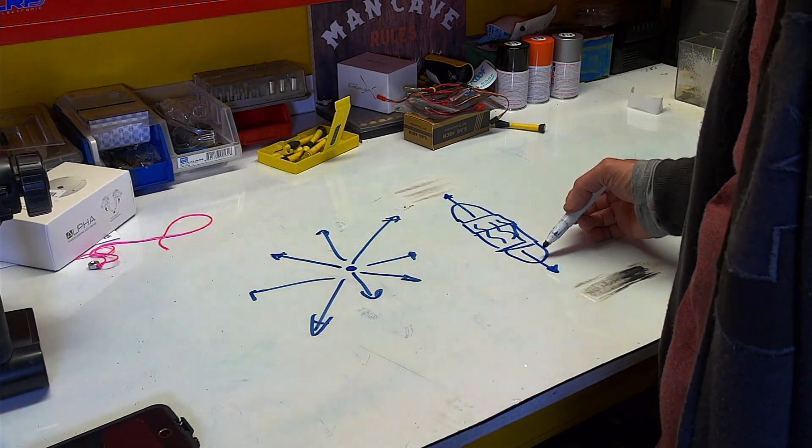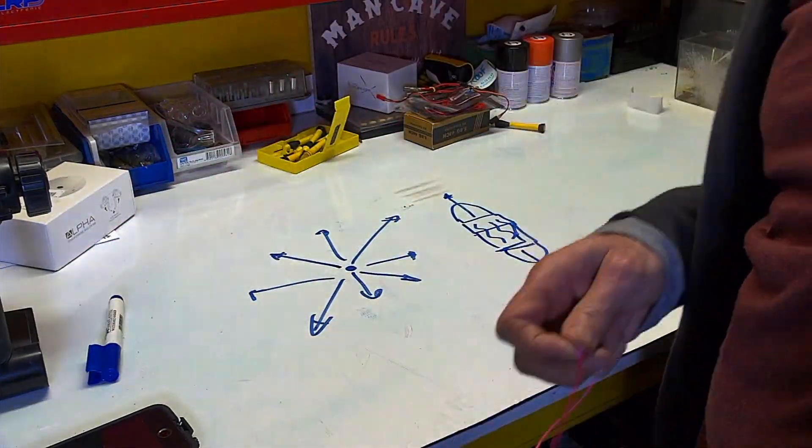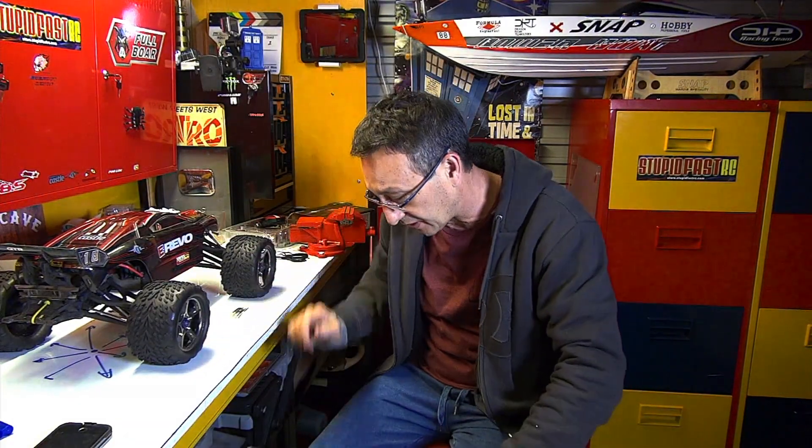That's what Jace has described as sharp edges — and that's ballooning. Now a very simple experiment to demonstrate how this works: you can do it with a nut and a piece of string. The nut moves away from the center, which would be the axle in the case of the car, and the faster it spins the more it wants to get away from the center, and the harder it pulls — which would make the wheels balloon even further.